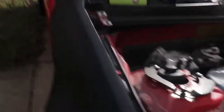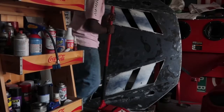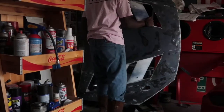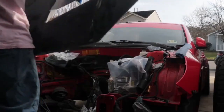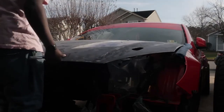If you want the fenders on, on the padding side you have this little button that's usually sitting right where that big hole is at. You want to take this out and make sure you put it on the finished fender — I think it's for the hood latch arm. I'm gonna use a step drill to drill that hole out bigger and make it fit. Make sure you install that if you're trying to keep the hood latch arm working.